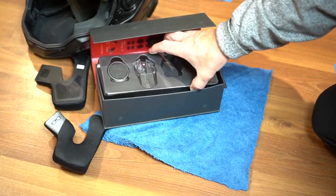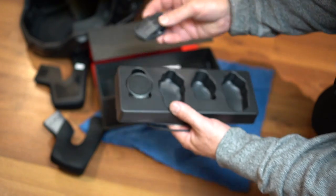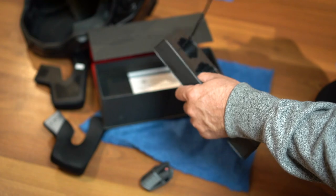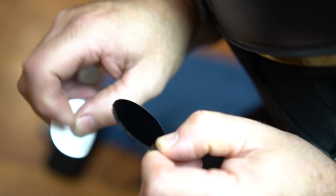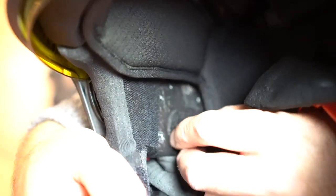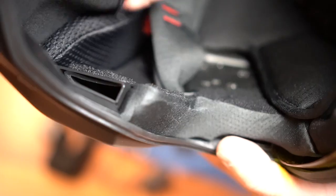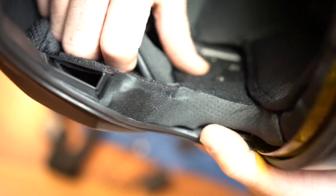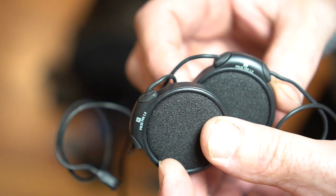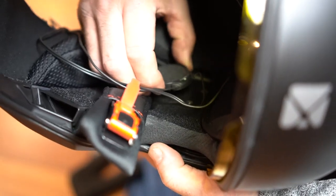We're going to open up the U-Clear Motion Series box. I've already had one communicator out and it's installed on the other helmet, so we're going to pop this communicator off and remove the ear pads from the box. We really don't need a whole lot — we need the two velcro pads. We'll line it up with that indent there and stick that down. We can grab the speakers and you'll see they're labeled right and left, so you really can't make a mistake. Line the speaker to the velcro, and then we can take this other speaker like that.